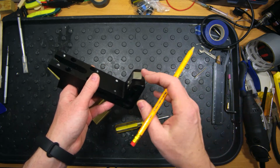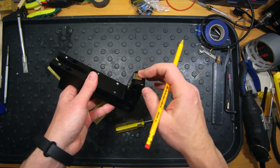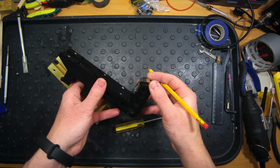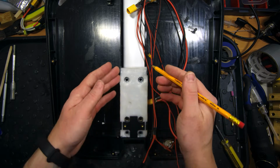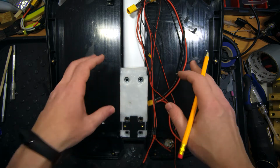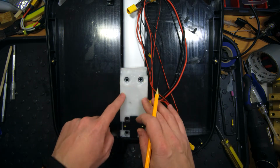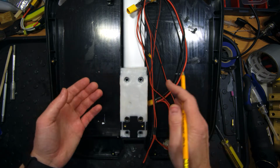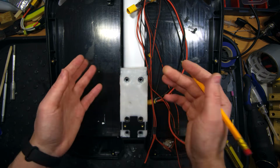Unlike the shitty springs from Begode, which I've seen on AliExpress, are really expensive. They cost a lot of money, and definitely this system should go directly to the trash can. Here I've also put a lot of attention to the reinforcement of the inner shell area where the pedal hangers are located. This is the side of the inner shell where batteries are located. So here I've melted a lot of plastic with extra big washers melted inside, which will significantly improve the contact area between the bolt and the plastic of the inner shell.